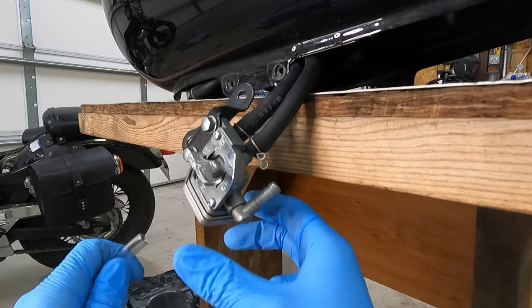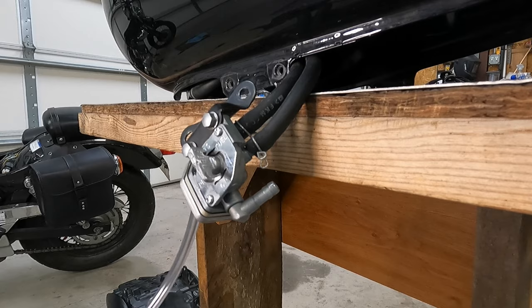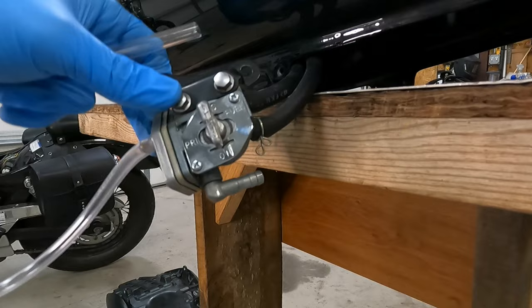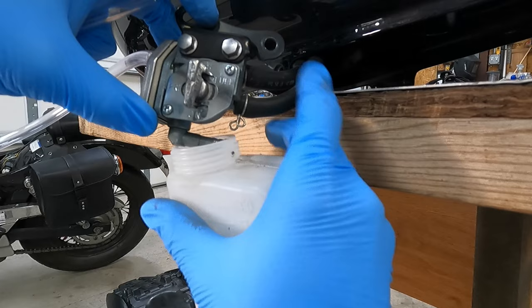So I've got this vinyl tube here in the shop — I buy the stuff at Lowe's or Home Depot in 10-foot sections. It's not fuel grade or anything like that, but it really does come in handy. I hooked this to the vacuum side and I'm just going to put the other end on my mouth and suck it like a straw, which should apply vacuum to open this diaphragm so we can test if the on position works.